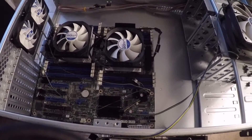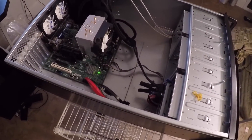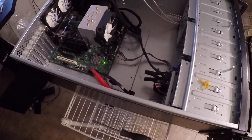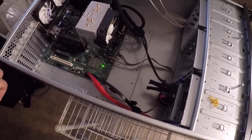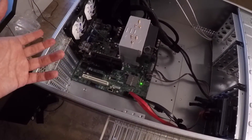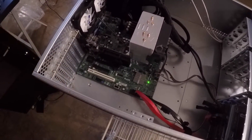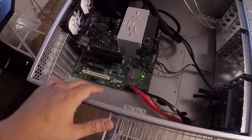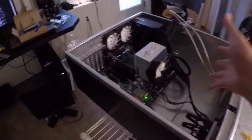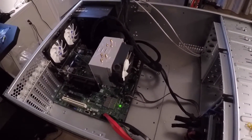I'm back with the server and made a few changes. After some thinking, I decided I don't really need that dual-socket board, so I'm just going to use an X8SIL with an X3470, 8 gigs of RAM, and a simple video card. Some of the servers I run need a D3D device so I can't use onboard video — it's really annoying but you have to have one. I went with an 8400 GS single-slot card. I stripped out that dual-socket board and now have a micro-ATX board with all the standoffs rearranged.